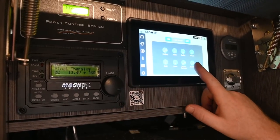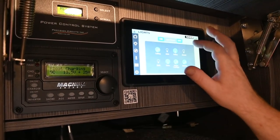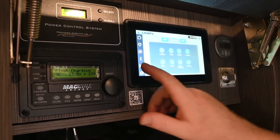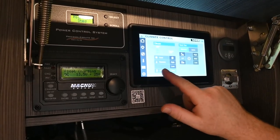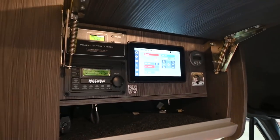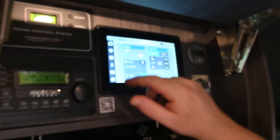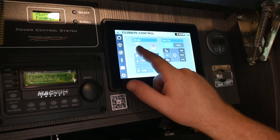Next are the lights. When you hit the master, note it only affects the interior lights — the outside lights stay on, and it takes a snapshot of whatever was on, so it will only turn back on whatever was previously on. Hold the on button to reset everything at full brightness. For the HVAC, we'll turn the furnace on first — turn the temperature up over ambient. The furnace is propane fired, so you need your propane service turned on. It takes about 10 to 15 seconds before it finally lights, and it's not easy on vans to tell it's running until you start feeling heat. The furnace does not shut off immediately when turned off, so give it a chance to stop on its own before you depower the unit.